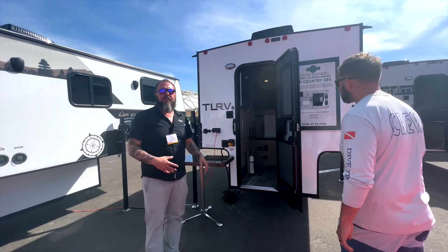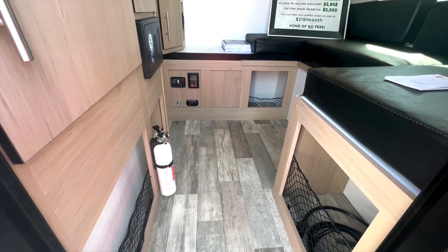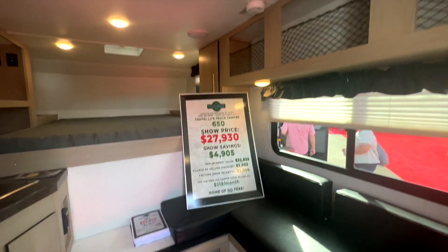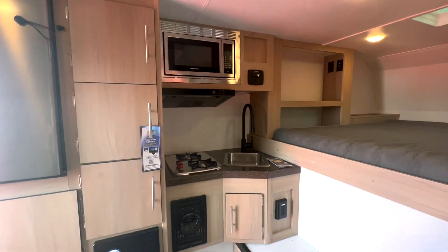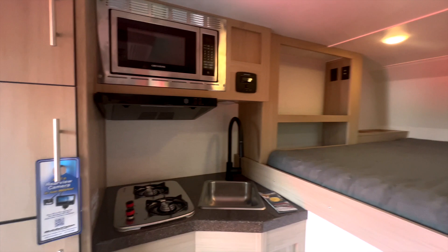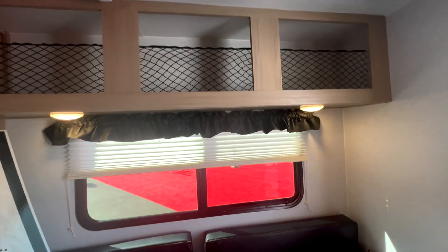This is the Upcountry — it's going to replace the Superlite series and the extended stay series of the old product lineup. It'll be built the same way with honeycomb composite floor and laminated sidewalls on an aluminum structure versus the wood structure we used to use. These are all Sika-flexed, then screwed together, with one-and-a-half-inch butyl in the corners to keep it sealed. If water did get in, the structure won't decay or rot. This is the 650 model — great for somebody with a six-foot or even a five-and-a-half-foot bed. You could put this on a half-ton pickup or up. With a five-and-a-half-foot bed, you leave the tailgate open for support; in an eight-foot bed you can actually close the tailgate.